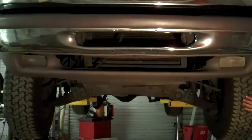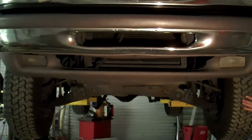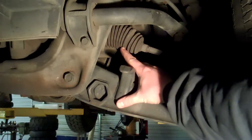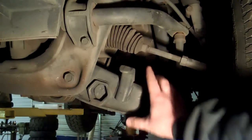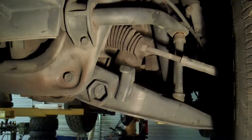If you look at the driver's side tire, the driver's side tire can move back and forth independently of the passenger side. That's because of a loose inner tie rod on the rack and pinion. The inner tie rod is right here — it connects to the rack and pinion inside of the bellows boot. I'm going to shake the tire again; try to watch the bellows boot. You can see that the inner tie rod is loose and it's moving around.